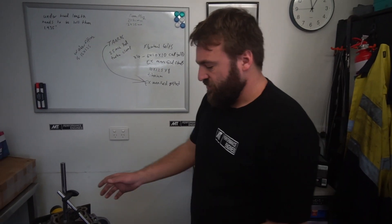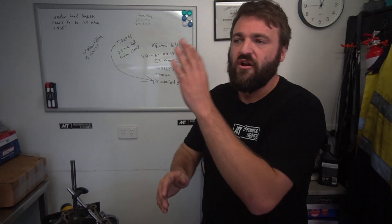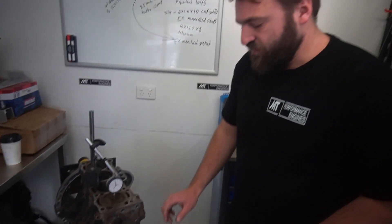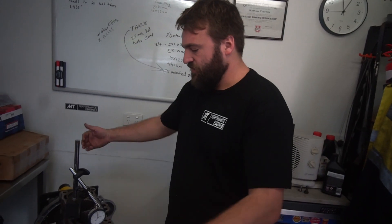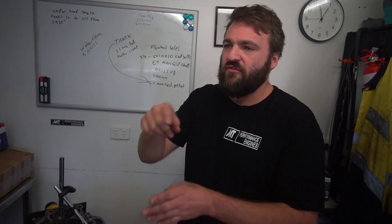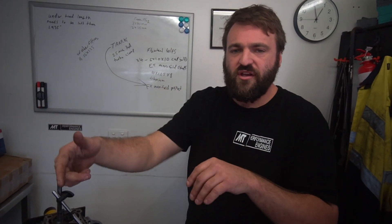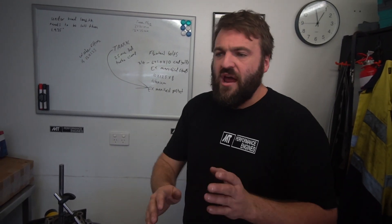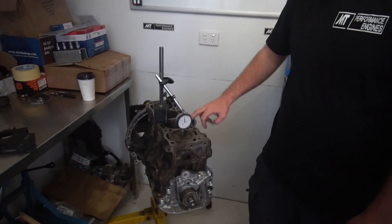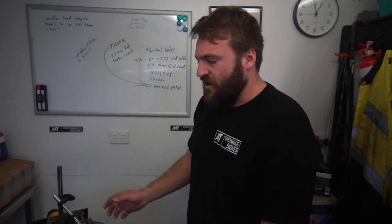So now when this goes into action in the car, we can set the dial gauge up on top of the motor with our balancer on, and we can clock to see if we are out in timing and check our phasing on the crankshaft. What that means is: when we go to tune the vehicle, we can actually program in the indexing offsets. When you work on a tune, you assume everything is 180 degrees out from each other — number one and four are directly in line, and two and three are exactly in line at that degree. But if we're out one or two degrees either side, we can program that into the ECU. So every time we put 10 degrees of timing into a cylinder, it actually gets 10 degrees — not 9, not 8, not 11, not 12 — it gets 10. And that's what we're looking to do here. It's a very simple thing to do, and you generally will not find these marks on an OEM balancer.